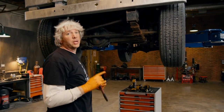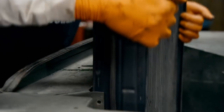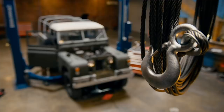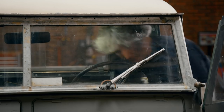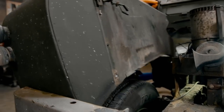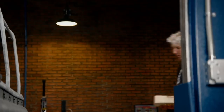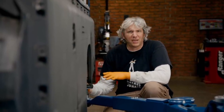I think that is pretty much everything on the underside. I now need to go topside and remove everything else. Up top, I have to drain and remove the radiator and oil cooler. I'm removing any electrical wires, especially those that lead into the cab. I'm pretty sure this is everything I need to disconnect in the cab. And now for the slam panel and wings. The last few bits of reinforcement and then we are ready to lift the body off the chassis, assuming I've undone everything.